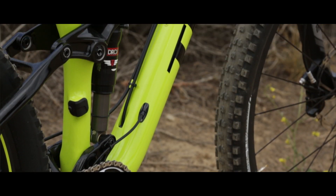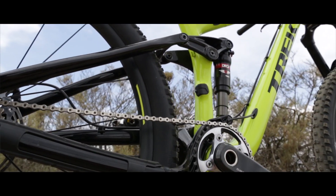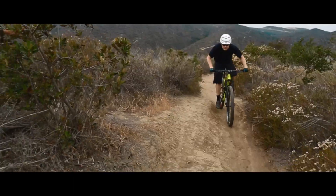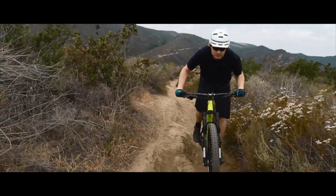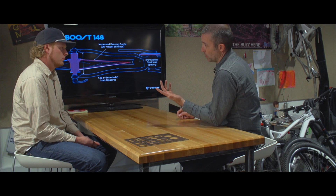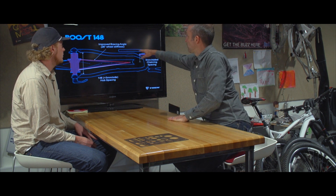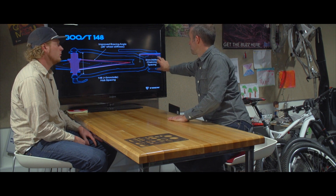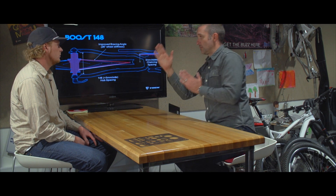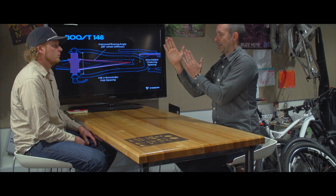If you can make a nice wide opening between the chain ring and the tire, you can get a better structure through there — more of a tubular structure, which is lighter and stiffer. There's also room to run cables through there: derailleur cables, brake housings. Importantly, they haven't increased your Q factor, so it's still a standard width BB and your feet are in the same place. The cranks haven't changed — they've just moved the chain ring outboard.